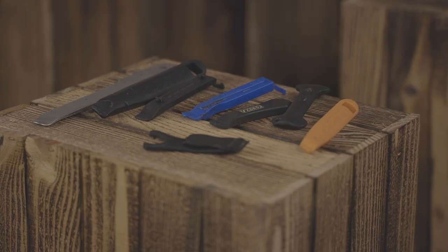The material for levers is thus plastic. That's it. Surely a metal lever's stronger? Well, back in the day I used to use metal tyre levers on my old BMX rims, along with metal spoon handles, flat-bladed screwdrivers — and sorry to my parents for ruining all the cutlery — but the truth is, metal tyre levers are great for motorcycles, but they're just too hard for use on soft alloy or carbon rims. Of course, it's a bit more nuanced than that, but only just.